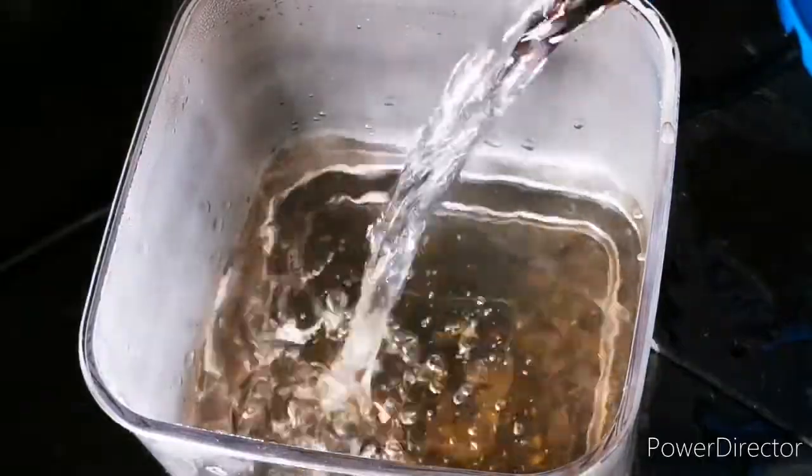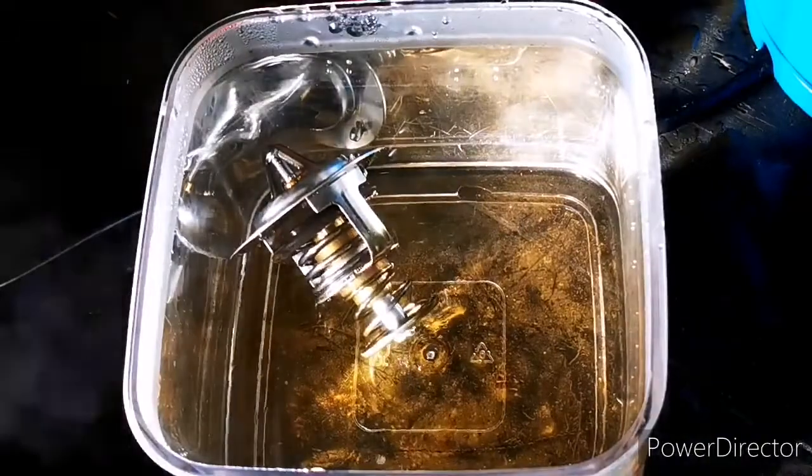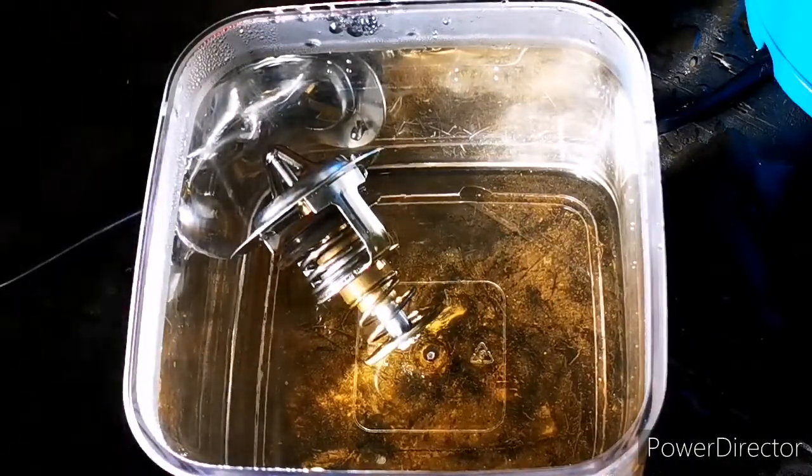So you want to get a container and fill it with boiling water. You want to make sure that the water is hotter than the temperature that's printed on the thermostat, and then once you place it in you can make sure that it opens and operates like normal. You can see this one's fine.